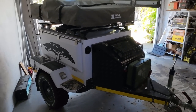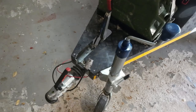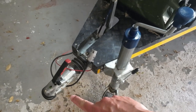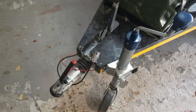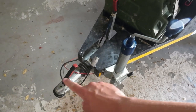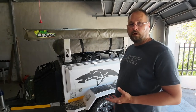From the tow ball perspective on the Jimny specifically, it's important to keep your tow ball weight at less than 75 kilograms. I try and aim for about 45 to 50 kilograms on the tow ball when we load the Genie as is. After our first tow to the Kalahari — there and back, about 3,600 kilometers — I am incredibly impressed with how the Genie towed behind the Jimny.